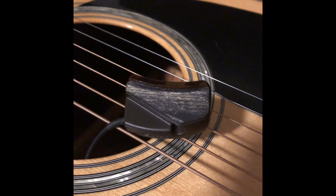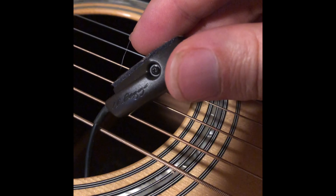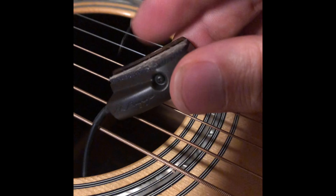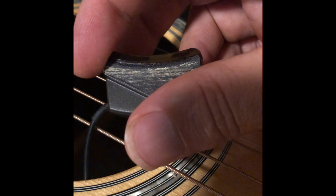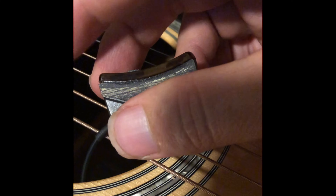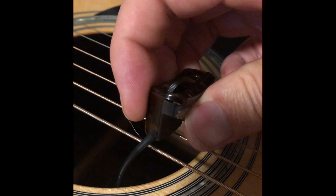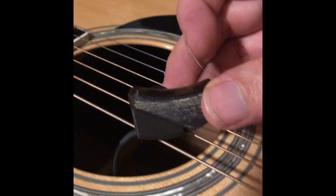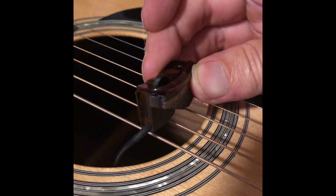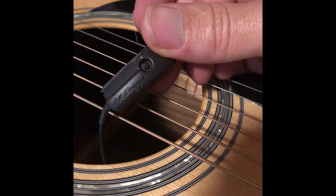I figured out the problem. See that little screw right there? It holds the top of this volume. If that sucker is loose, this top plastic piece will separate and you can kind of see a little gap in there. I don't know how well you're going to be able to see this on a cell phone video. But that little screw — tighten that sucker down.